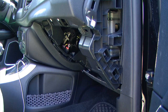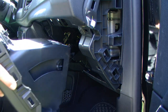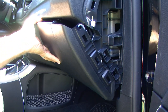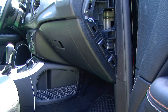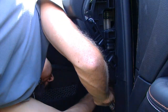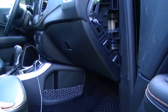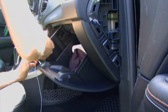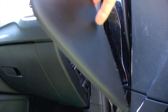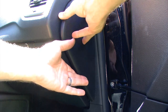After that we can very gently work on the glove box, connecting the wiring harness to the glove box light, and reinstall our six Torx head screws — one on the side, two on the bottom, and three inside the glove box. And lastly, we can install that door side panel.